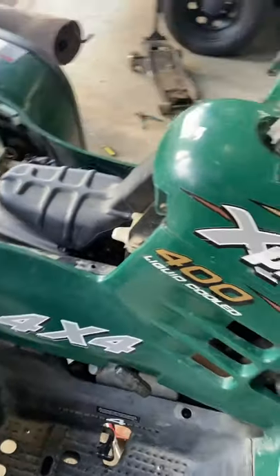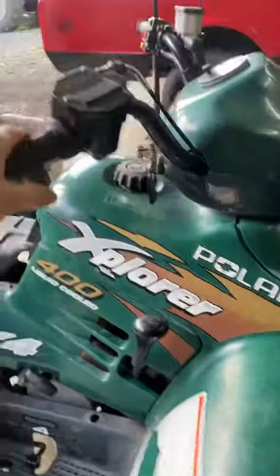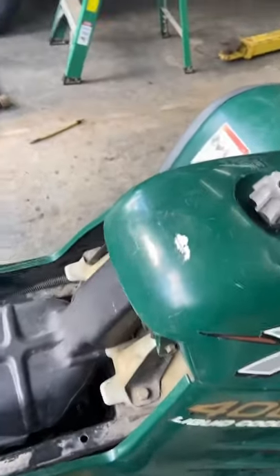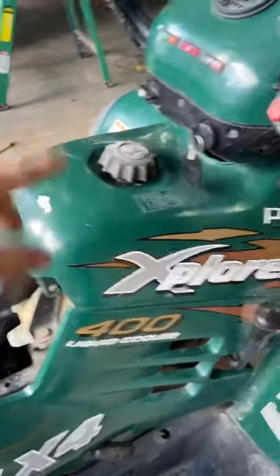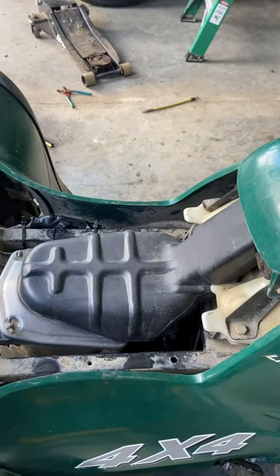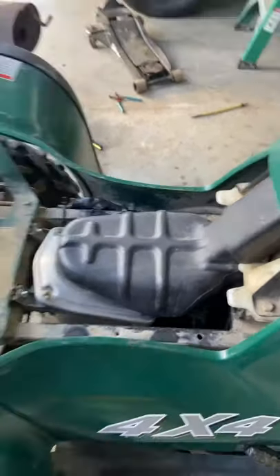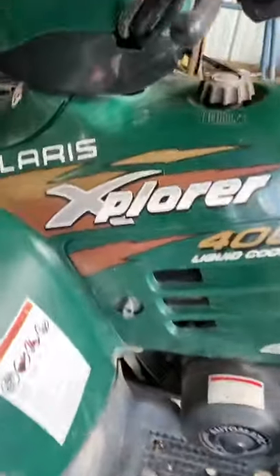Is it the fuel needle not seated all the way in your carburetor, letting fuel dump straight into the motor? In my case, the oil injection pump failed and instead of not giving enough oil, it did something weird where it was putting too much oil in. So I just blocked that off and now we pre-mix the fuel for it. Figure out what actually caused the issue — why there's extra fuel and oil in the crankcase — otherwise you're gonna have the same issue over again. Hope that helps. If you liked the video, slap a like on it, subscribe, all that good stuff, and I'll see you in the next one.